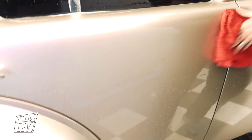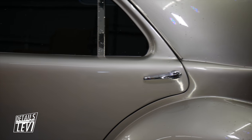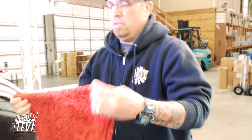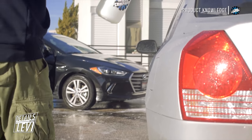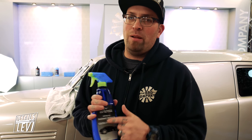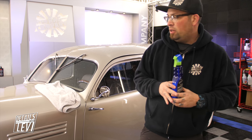I was a dumb 14-year-old kid just trying to get the car clean and make it look nice. You're probably wondering what we're doing about the other side that's starting to dry — the good news is because this is a polymer we're applying, it's going to dry into a polymer spot, not a water spot. All we have to do is re-wet the surface with a little more ONR and then dry it. It's 52 degrees in here, which is why I'm wearing a hoodie, but we're going to use the Instant Detailer Gloss Enhancer as our drying aid — it adds extra lubricity and we get the added benefit of the gloss enhancers formulated into this product, giving us an instantaneous gloss pop.